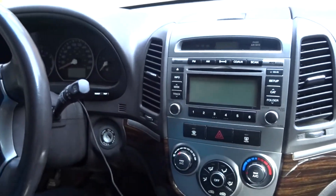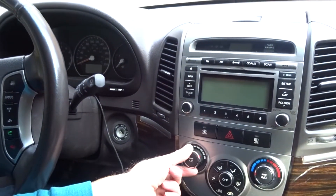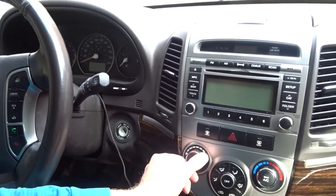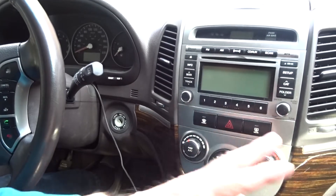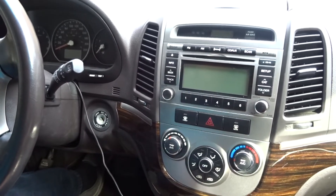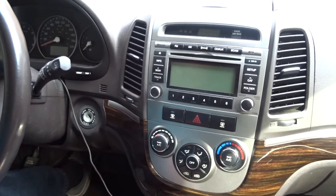Hello and welcome to Gary's Garage. Today I'm inside the Santa Fe. What we're working on is the heater control, and specifically the fan. This knob is not working properly — you set the fan speed and as you drive it speeds up and slows down. I had checked the resistor for the fan that helps control the actual speed, and that is fine.